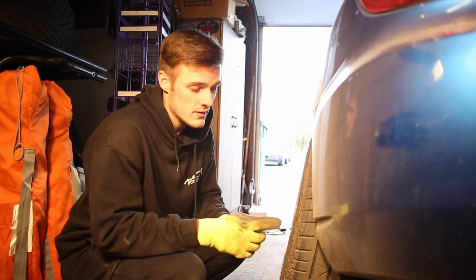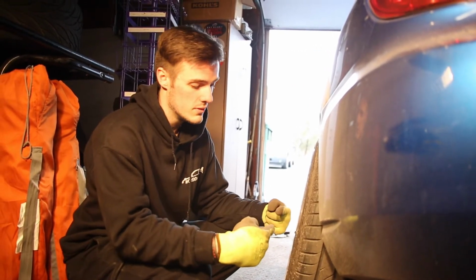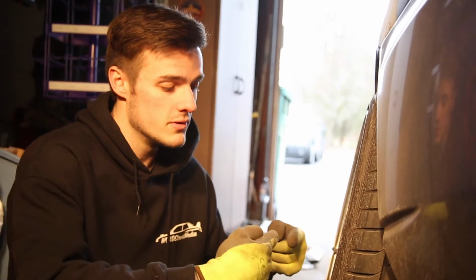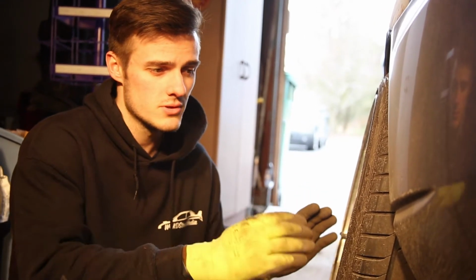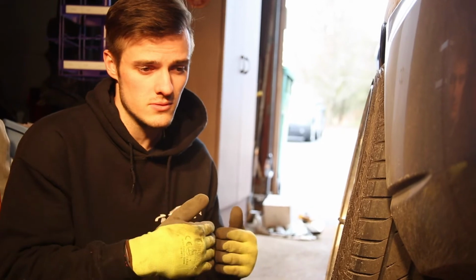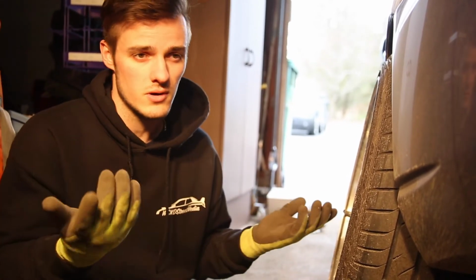Along with that, the back side's extended too far, so it's pushing the wheel out too much. And then also there's a bolt that goes to the back of both of those links on the subframe, and that's exactly where the camber bolt is, and we have it flipped the wrong way. So if we flip it the other way, it should help push a little bit more camber, as well as we're going to need to adjust the trailing arms, which I'm going to let the shop do so that they have the perfect alignment, but we can at least flip the bolt around because it's just a bolt.